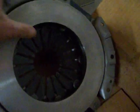when we get to that part of stabbing it, gotta look at little things like right down in here. This part right here is called a throwout bearing. The kit comes with one, and I'll show you what the kit looks like. Get a throwout bearing. You get another little bushing right here, which this is your aligning key to align the disc. And yeah, fair warning, this thing's heavy. This is what is our next step. So I guess this is from a transmission drop, what we're going to call this clutch assembly.